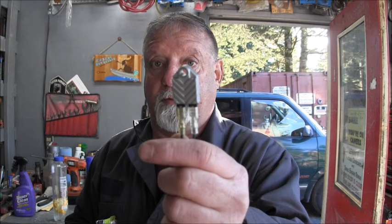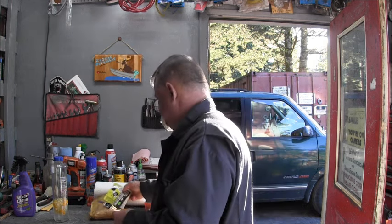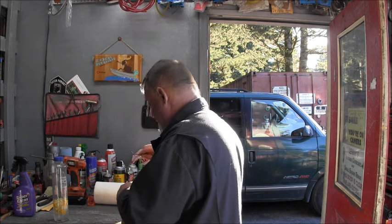These, for whatever reason, seem to short out and lose spark. I don't know why, but I wish they still made these. Like I said, if you've got more experience with them than me, and I will admit, over the years, these earlier two-cycle Suzukis have an oddity. I even read about it on the CDI Electronics troubleshooting website a couple years back. And at that time, I kind of figured out what was going on. They have a higher voltage system. Just something is different with these Suzukis.